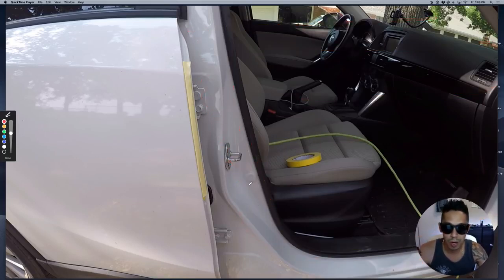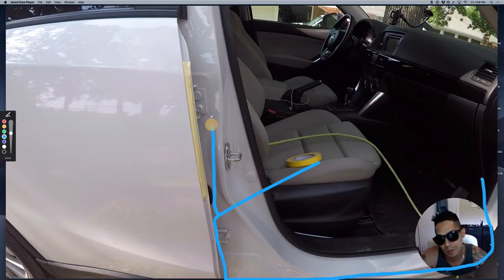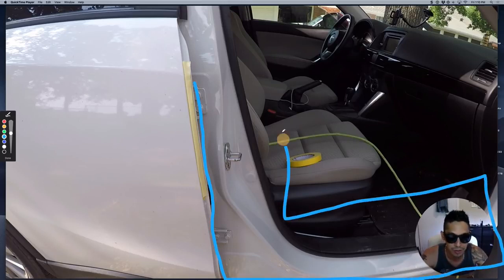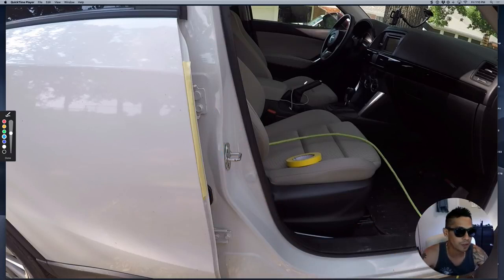What I'm saying is you might need to put a sheet of paper just in this area inside the door jamb to cover it so you get no overspray. You can even do the interior area as well if you want to be extra protective. You can cover it with paper — just one single sheet, like an eight-inch roll of paper — overlapped inside. So when you close your door, you've got that tape protection and the paper masking inside.